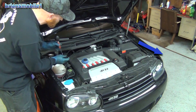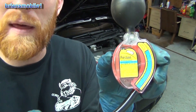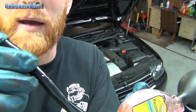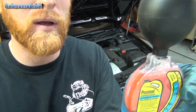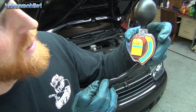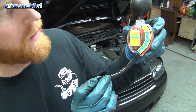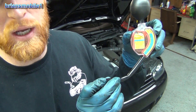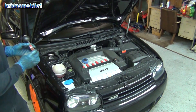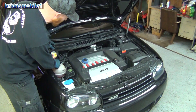Here's a great big tester, real easy to read. When you look at this you can see there's an arrow — it looks like it's pointing at about negative 50 Fahrenheit for a freeze point, so he's in great shape. Depending on where you live: if you live in Nome, Alaska you're going to need all of that; if you live here you need to be good to at least negative 20.